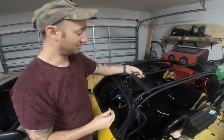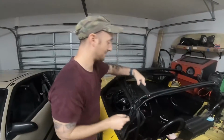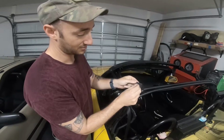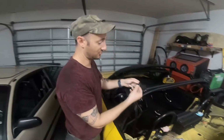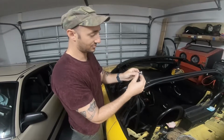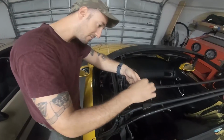All right, so the straps we're gonna put on first. Already riveted those to it. Take a little metal piece. Well, before you take the metal piece, I guess. These straps are really nice, and the holes in here are real nice and tight. I just stuck the rivets through them first to make it easier to stick it through. Take the little metal piece you took off earlier. Stick them through. And you're literally just gonna find the holes that were there that you drilled out.